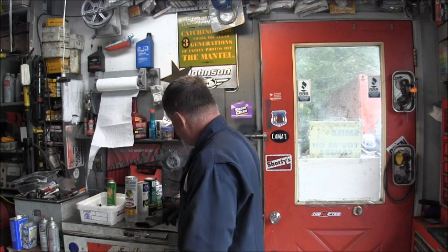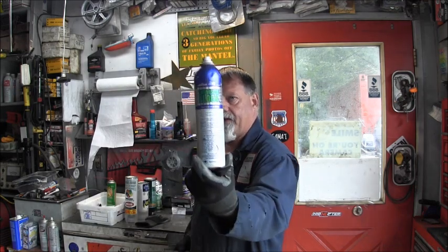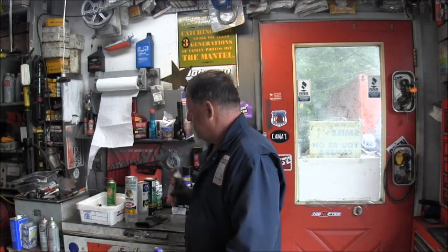Then of course you're going to bring it out after a good scrubbing and a good bath, and you're going to air blow dry it with compressed air, and then you're going to get your other friends. Stuff like this. Soap, lubricants, and fresh water are not the enemy. Salt is the enemy. At least that's my humble opinion. I've been hosing down outboards, plunging them in fresh water for a long, long, long time. I've never had an outboard go bad because of fresh water, soap and lubricants.